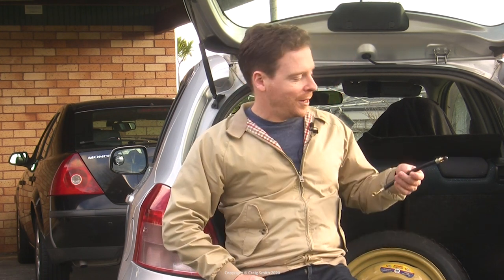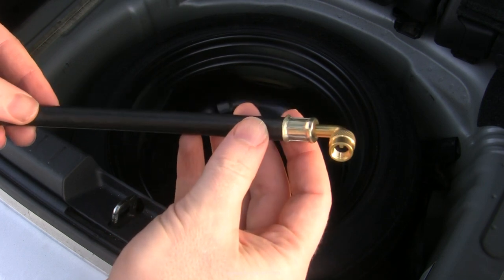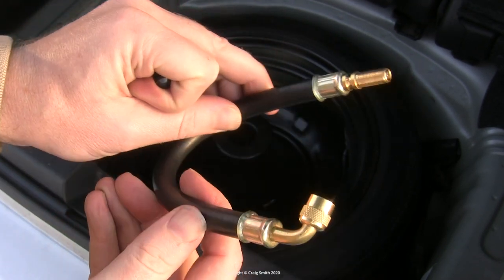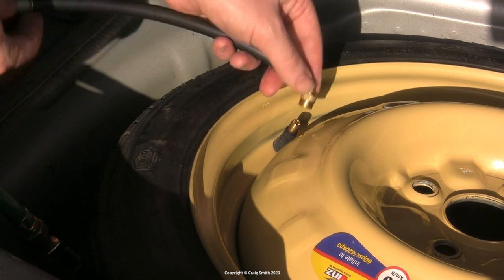I'm not here just to rant about Toyota's design decisions, because this irritated me once too many times in the rain and I decided to find a solution - which is this. This is simply a Schrader valve extension tube with a brass right-angle adapter on one end. The female end attaches to the wheel, and the other end is a regular Schrader valve to which you attach the pump. I'm going to install this with the wheel in its regular factory position, and this hose - I think it's 10 inches - is just the right length to wrap around the tire and poke up to the top.